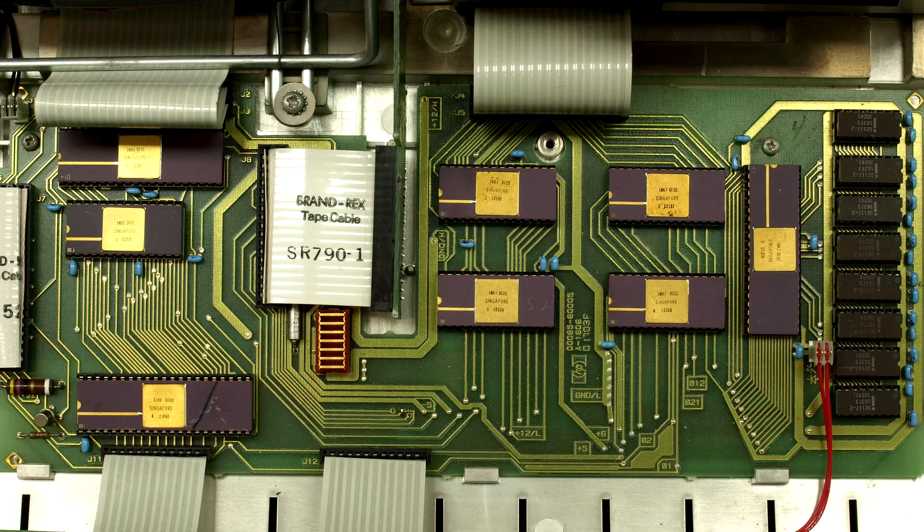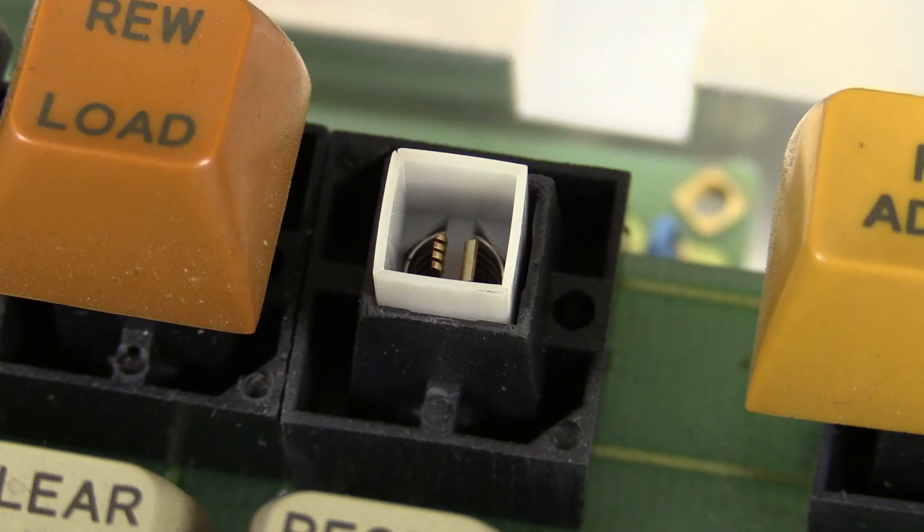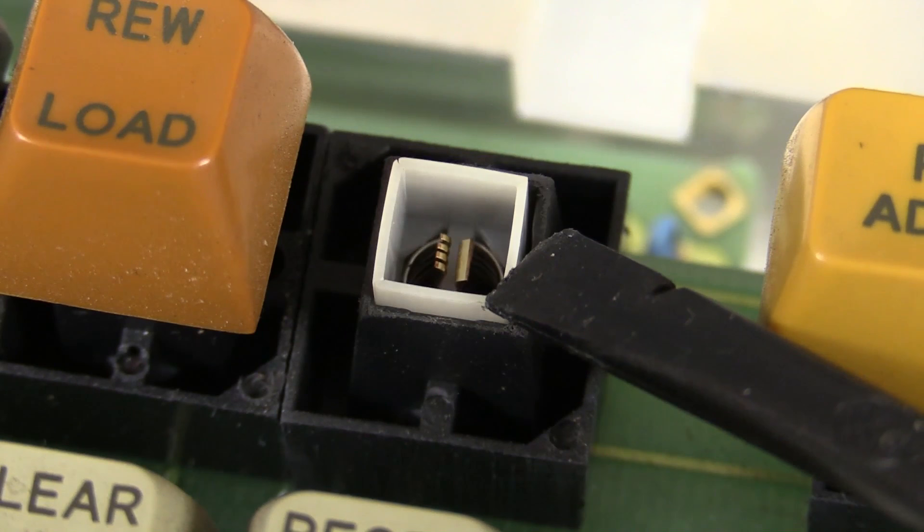Check out the tape — goes straight up to the cassette and the printer. No interface at all, just drives the lines. The CPU doesn't just have one clock — it's a four-phase clock. One thing you don't see on here is a crystal oscillator, so maybe it's got an internal RC oscillator. And for all you switch aficionados — four wipes on each one.